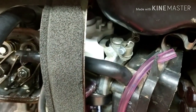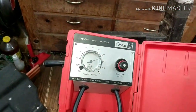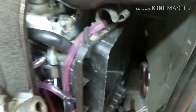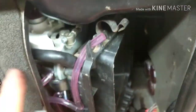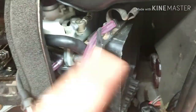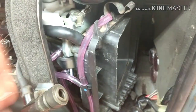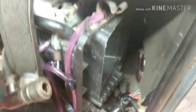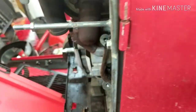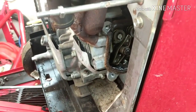We've got something going on with our intake valve. I'm going to pull the head off and check it out. But yeah, 27 percent leak down is way too much. What's happening is, because it's got so much leak down past the intake valve, it's blowing air back and forth in and out of the carburetor, causing it to run really rich. It's going to cause surging, foul plugs, and shut off. If you have a generator running to keep things going during a power outage, you can't have it running rich like this.